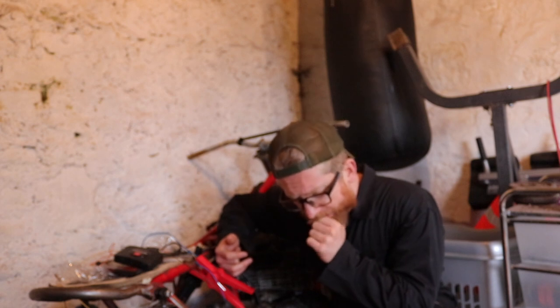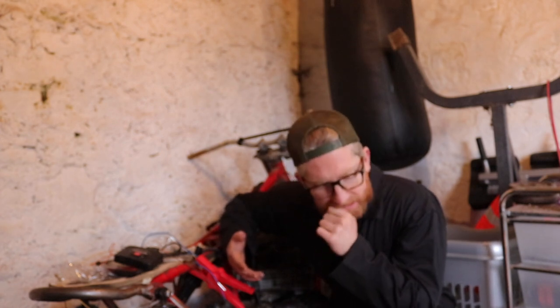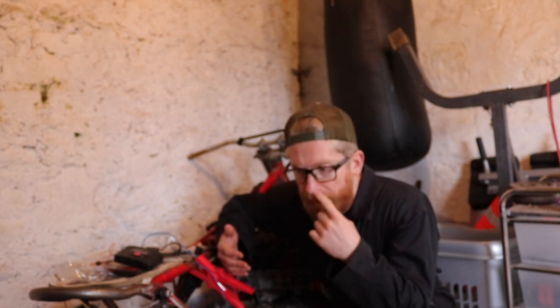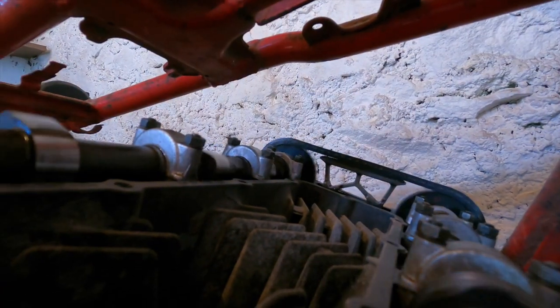So what I've done is committed to running the bike anyway. I was watching a video by Classic Octane, Taylor over at Classic Octane. I don't watch a lot of his videos, but I do quite like him, and I like his approach to builds. He had an old CB750 where one of the cylinders was low in compression, and his logic was, when you leave these bikes, stored correctly or incorrectly, there's going to be a valve that's not closed or not open, halfway through a cycle. This valve might get a little bit sticky, or a piston stuck in a position, where running the starter motor can help get that moved a little bit, but nothing like 5,000 RPM for 30 seconds a minute is really going to clear that with combustion and everything else.